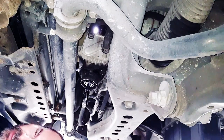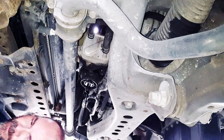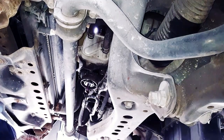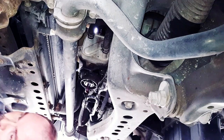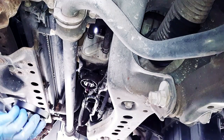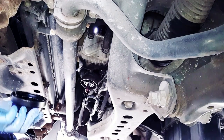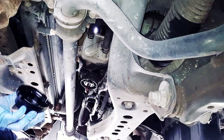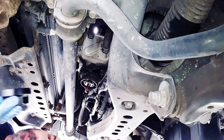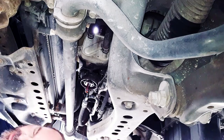There's no o-ring on this piece, but I can see it's up in there, so that'll be something we change along with the filter and the other o-rings. The Motivex filter wrench fits everything from the 2-liter Toyota, Lexus, and Scion up to the 5.7 Tundra — the only thing it doesn't fit is the 1.8-liter Toyota, and it doesn't fit regular spin-on filters. It's got three little notches on one side and one on the other, so it's only going to fit one way.